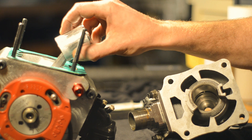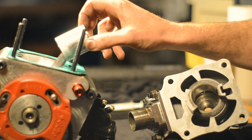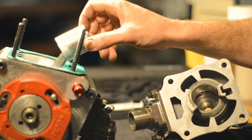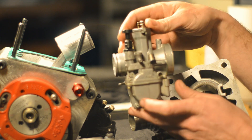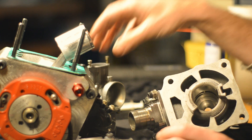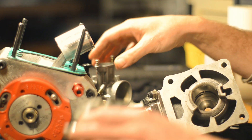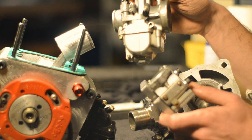The piston skirt has not come loose, the clearance between the ring and the ring land is the same, the ring is not bound, and the gap has not become excessively large. Let's have a look at the carb - I suspect the float needle is not seating properly and it's leaking. That's not the carb I'm going to use though; it's this one - it's more compact and immune to vibration, which the other one certainly isn't.